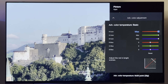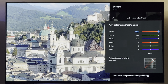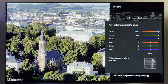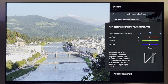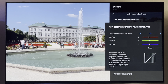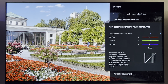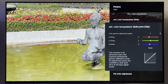Advanced color temperature: R gain max, G gain max, B gain max. R bias and everything underneath that — all the biases — are zero. Advanced color temperature multi-point: switch this back to one if it's not already on one to start. At point one: R offset is negative 7, green offset is 2, B offset is negative 4.